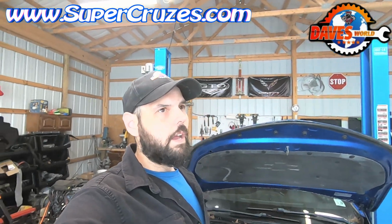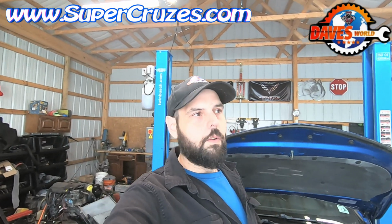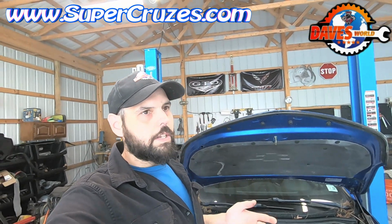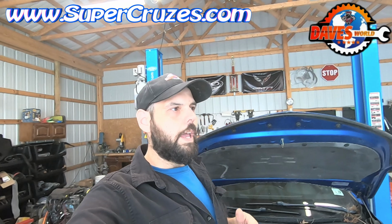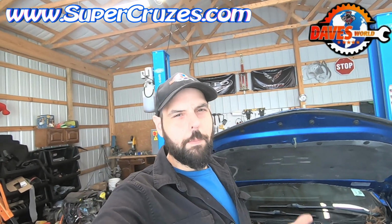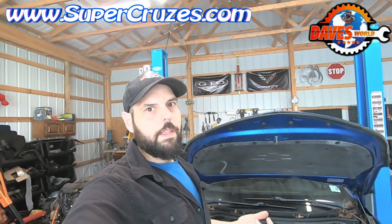Pretty much every time, I want to say if there's 10 people that don't have the flex fuel working correctly, 2 of them maybe the flex wasn't activated in the ECM tune. The rest were all just the pin wasn't in all the way, or the fuse was in the wrong spot, just something dumb that could be easily fixed just because a person's putting this in for the first time and they had no idea. That's why I bring that up.